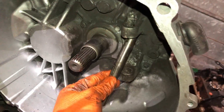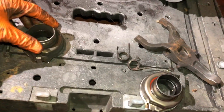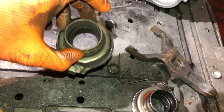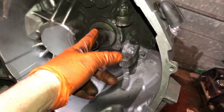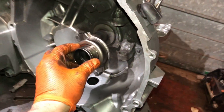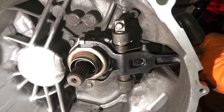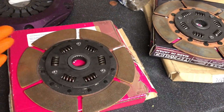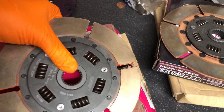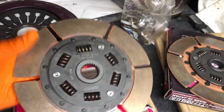Release bearing change time. I've just pulled out the arm and the pin. The pin just goes up in here - I'll show you when it's all assembled. You've got to pull the cap out the top of the box while it's all apart, might as well lube it all up. You can see the old one - it doesn't look like it was changed with the last clutch change, it's a proper state. So we've got a nice fresh new one. I'm going to copper grease up this shaft - I've just cleaned it with some brake cleaner - and then get this new release bearing on. Release bearing's been swapped over, springs and everything back in, working smooth. Now onto getting this clutch fitted - you've got two discs, so you need to know which way around they go.